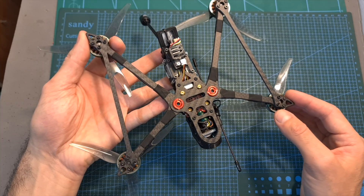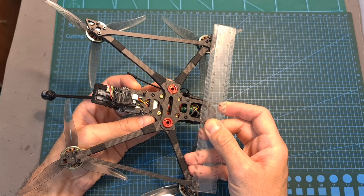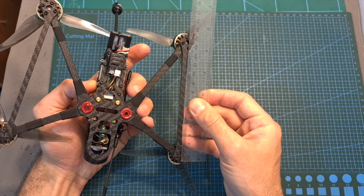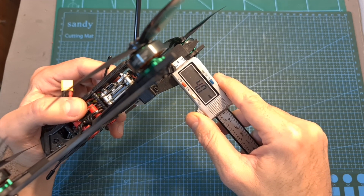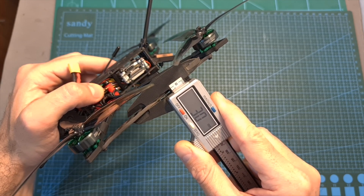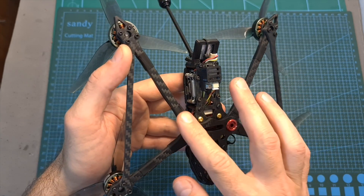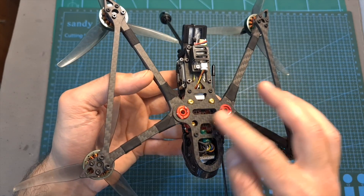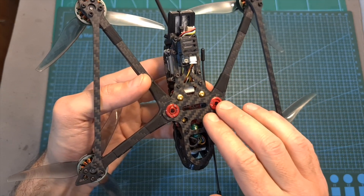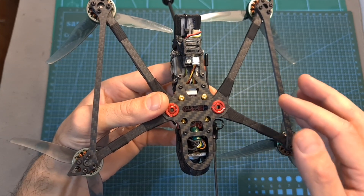As for the Recon 5 frame, which is also available separately, its wheelbase is 210mm. It features a dead cat pattern, so the propellers are going to show slightly on your FPV feed, but won't appear at all on your HD footage. The thickness of the carbon fiber arms is 4mm, and the side supporting arms — which I recommend to install, as they will reduce jello and improve frame durability — are 3mm. The arms are secured to the bottom plate using two bolts, and I recommend that AJR-C/Recon FPV include a tool to fasten them, as my arms came a little loose and I had to improvise tools to secure them.